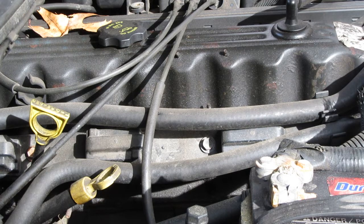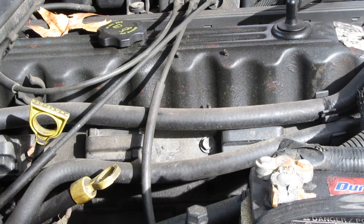A few nights ago I was having the problem where this Jeep was running real rough. I tried cutting the cat out — I thought that might be the issue, but that was not it. The reason I don't think it's the pre-cats on the Y-pipe is that it's only throwing codes for misfires. The cats on the Y-pipe on 4-liter Jeep engines are monitored by O2 sensors, so if there was something wrong with those, I'd be getting O2 OBD2 codes, and that's not the case. So it's feeling more now like a tune-up issue — like it's not getting spark, it's not getting fuel.